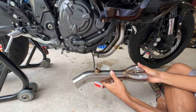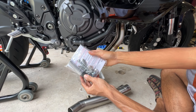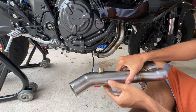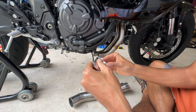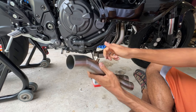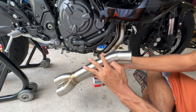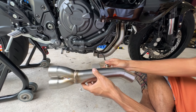Now we have the middle piping. The O2 sensor does not fit in here because it's small — they provide you with some adapters that you can use. What I'm going to do first is throw on some anti-seize on there, just in case I ever want to take it off and don't want it seizing up on me. Then I'm going to put the O2 sensor on first, but I'm going to screw it on like this so that way the wire isn't all tangled up.